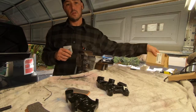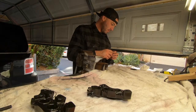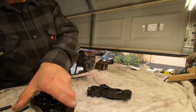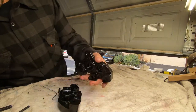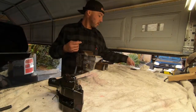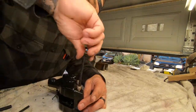I just wanted to make sure that the rotor itself wasn't going to cut into the brake or any metal. These are brakes from a trike or bagger. I put only half of it on, bolted it on, had the brake in there, and just wanted to see exactly where the pad was going to rub. It looked like it was going to be just fine. Same size rotor as the stock rotor that comes on my bike — 2014 or 2013 FXDC. It's pretty much all OEM sizes, but I have the trike brakes going in — going from that single brake to that dual disc brake. I'm using the V-Rod front end, pretty much Frankensteined.